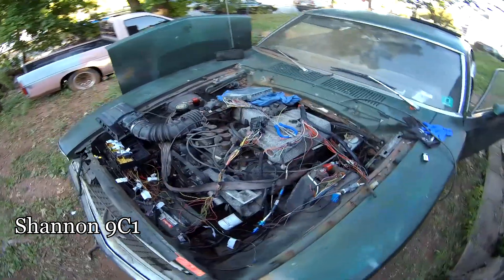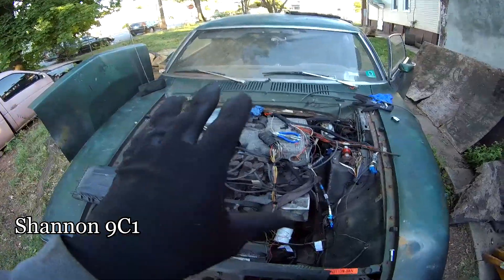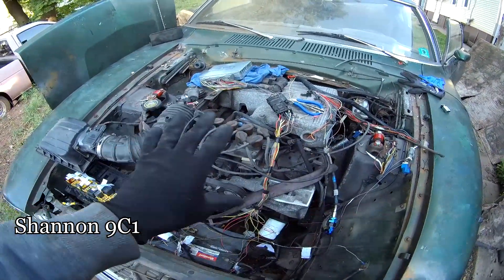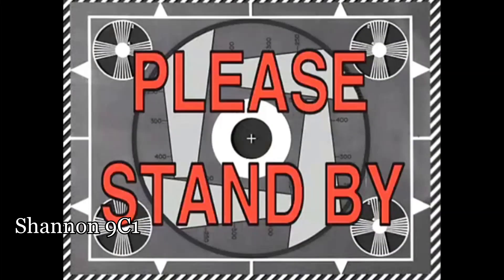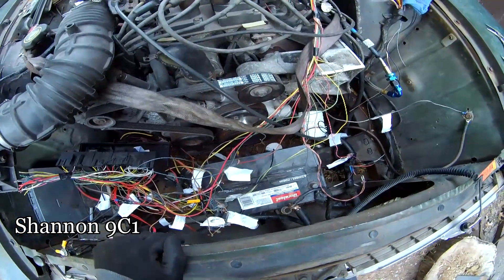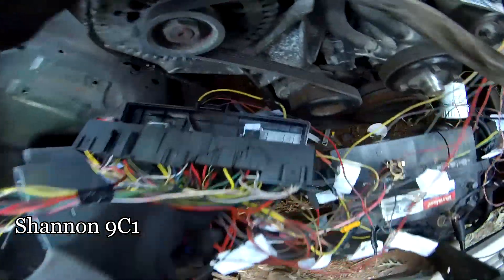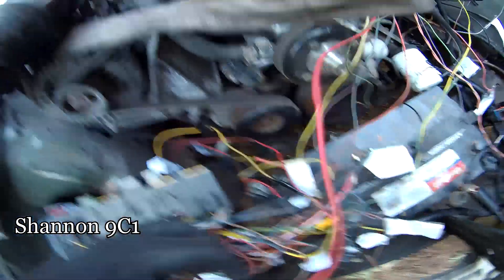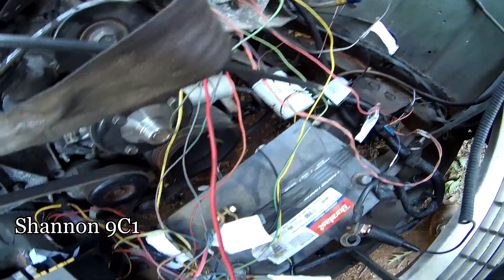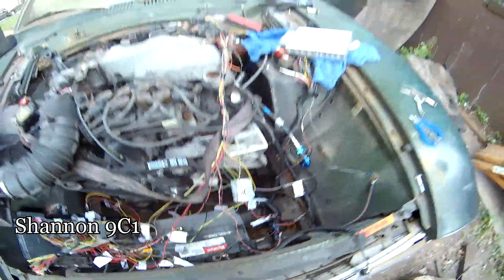The injectors aren't firing. I'm going to turn this camera off and figure out that wiring — it's just too much. That was another hour. What I found out is the ECU didn't have any power. This is a relay — the ECU power relay — I didn't hook any power to it. The injectors started to get a little light but it was real dim.